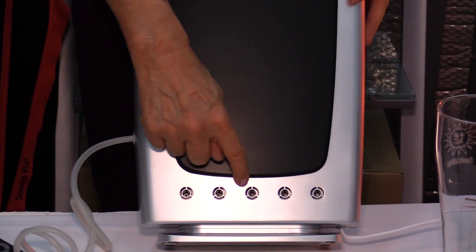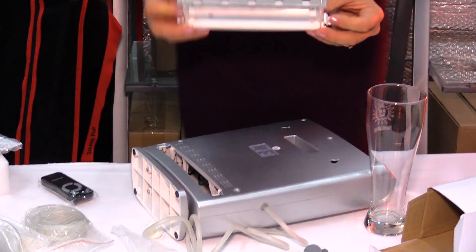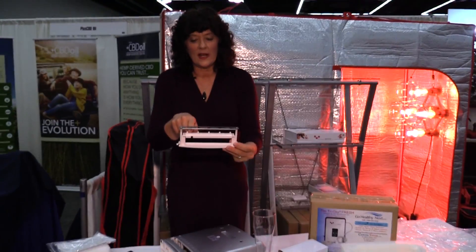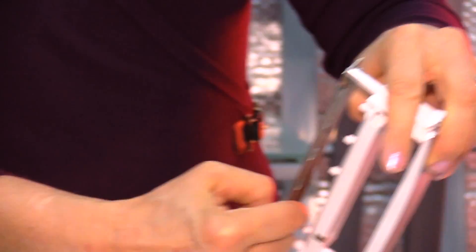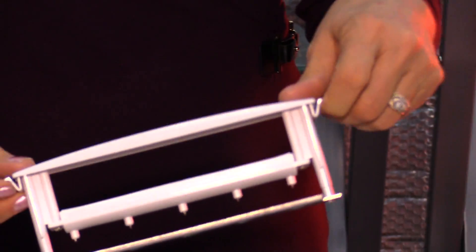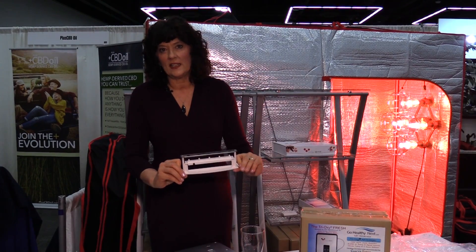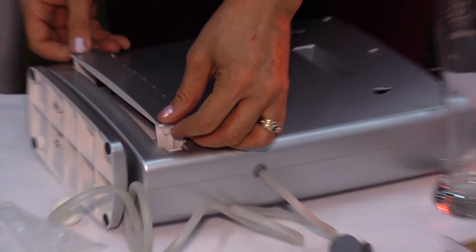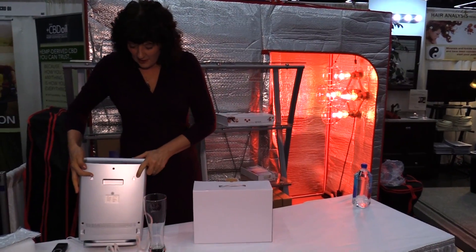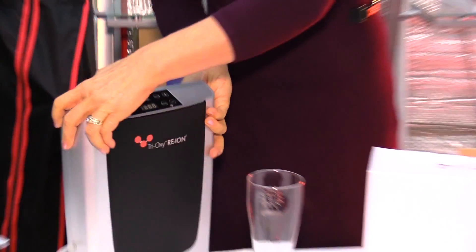The plasma comes out of these five holes. There is a discharge needle — you push these in here. This is the discharge plate. Dirt will accumulate on this plate and on the needles, reducing the quantity of plasma produced, so you want to periodically remove and clean it. It just snaps back in. You can use the screws to mount it on the back of a kitchen cabinet, or you can set it up straight.